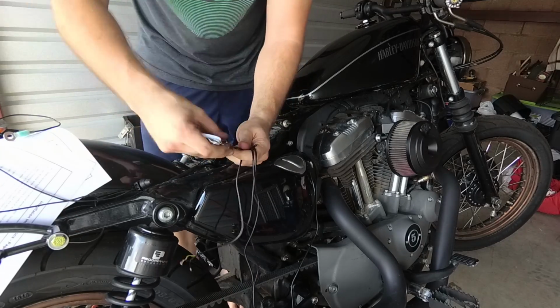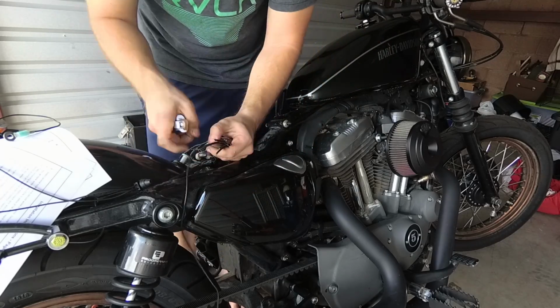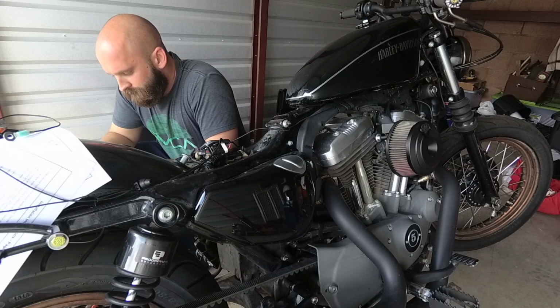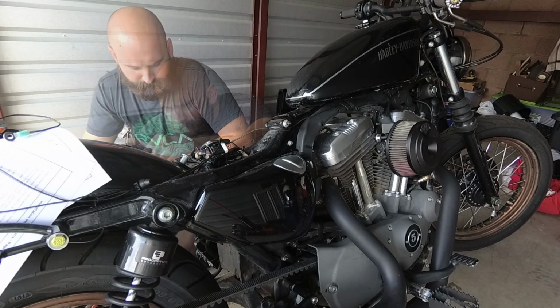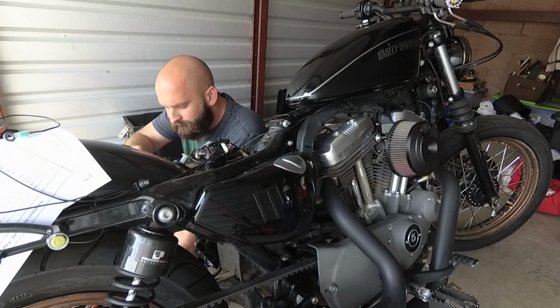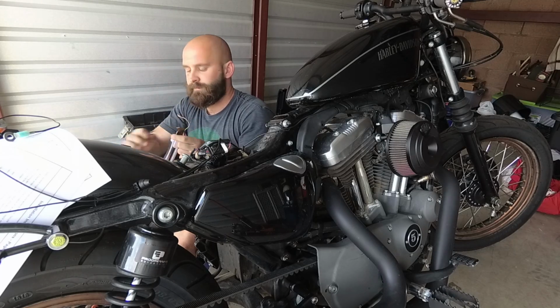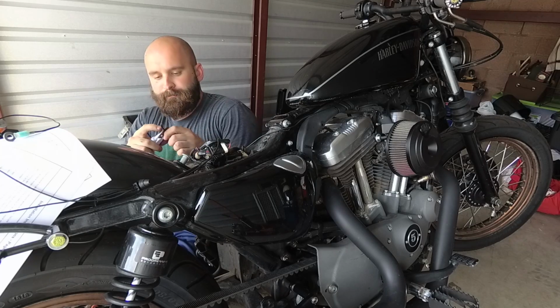Hey, Daniel, this is Custom Dynamics. How you doing today? Doing good. Just trying to figure this out. Sure. It sounds like you've installed some Magic Flex 2 lights with a BM Remote 4, hooked them up, everything's working fine, put the seat back on, and now they won't turn on. Is that right? Pretty much, yeah. Basically, what's happening is the BM Remote 4 is constantly sending out 12 volts. And when you hit the on button, it's actually making the connection through ground. So when we're taking them out, we're going to go directly to ground, and those LEDs should illuminate. So attached to the ones that are disconnected to a ground, or just one of them?